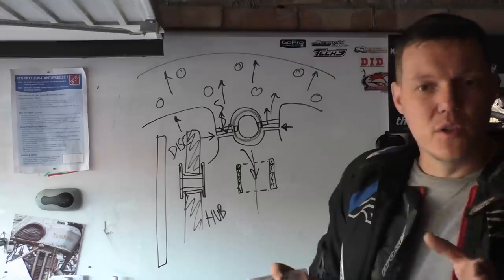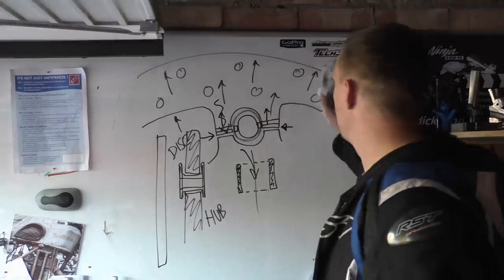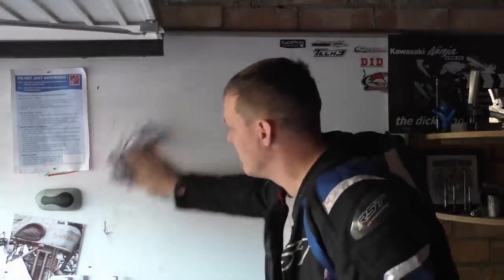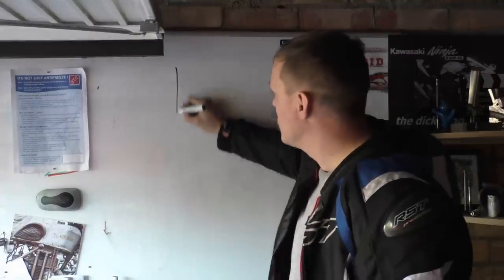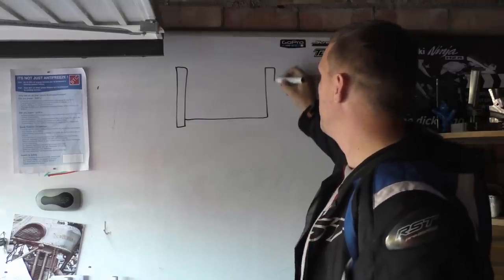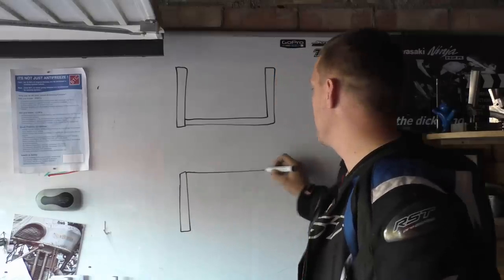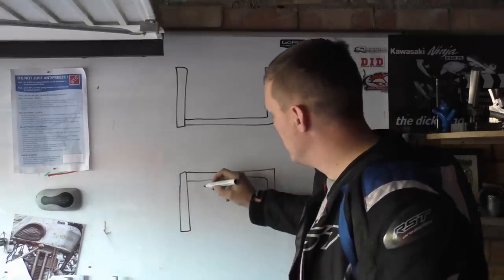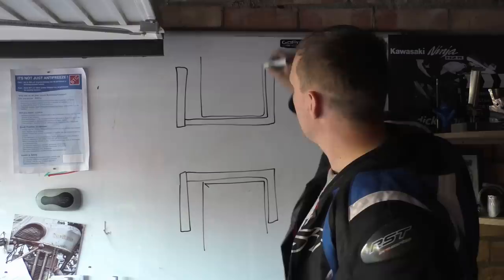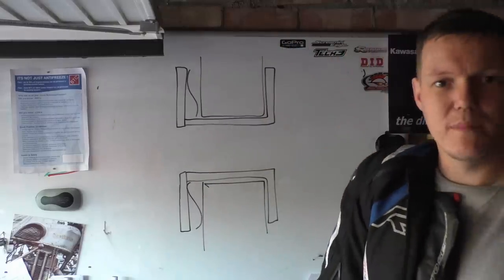And you'll notice that on a lot of these bobbins, let me clean all of this off, they'll have the inner shank, they'll then have the riveted side where they've been pressed together. Some are made totally differently, depends how they're pressed together. And then what you'll notice is your disc fits in here like this, and there's a bevel washer in there between there.